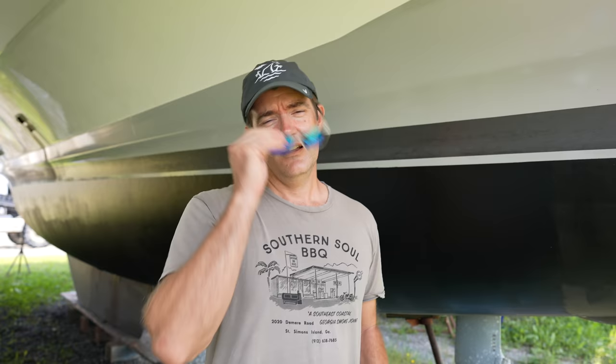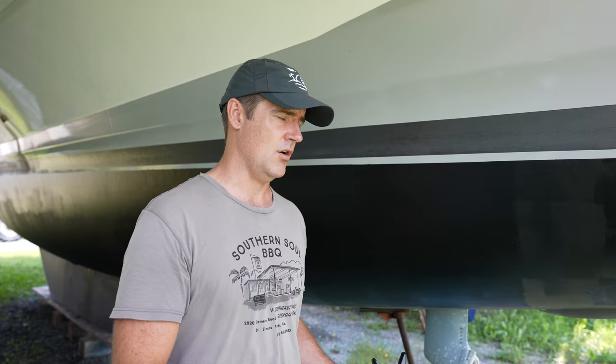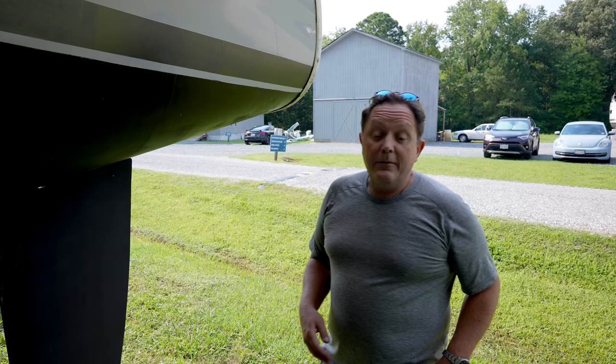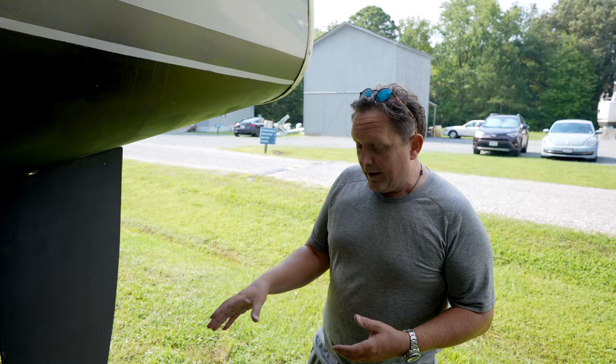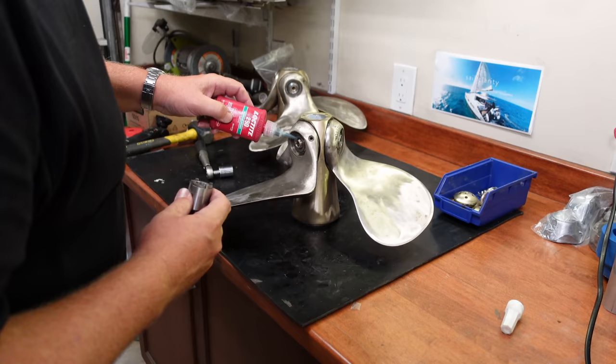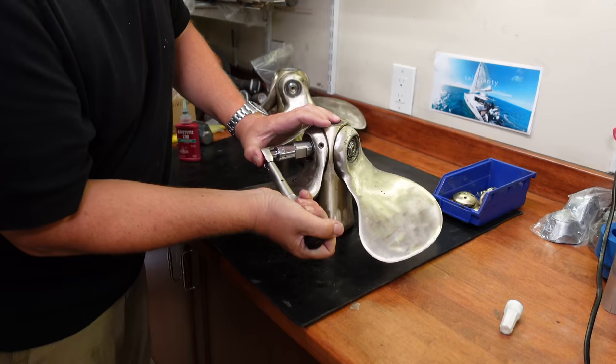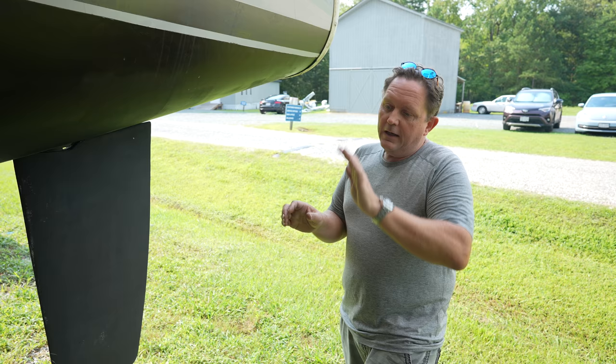All right, so I rebuilt these three times. What was I possibly doing wrong here? Where would somebody else who's servicing their own props possibly be going wrong? Okay. When you service your own props, there's a couple of things you can look out for. The main thing is when you're tightening it, I spend probably half an hour playing with the blades. I have a little torque meter off a bicycle, and once I've done that, it says 16 newton meters, 18 newton meters, about 13 foot-pounds or something. And my blades kind of fall like this, quite slow.